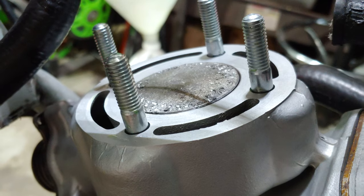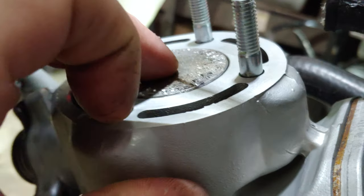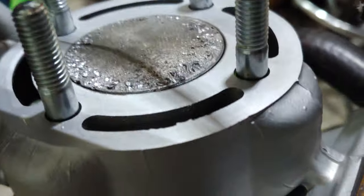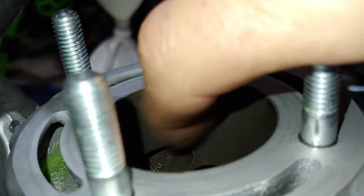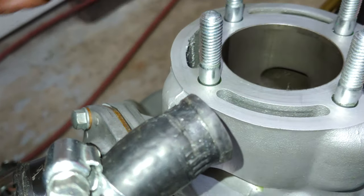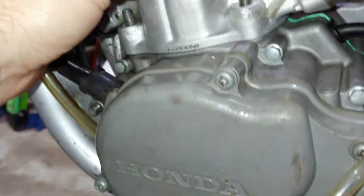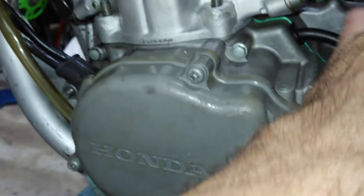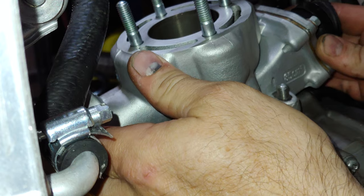At 12 to 14 thousand RPMs these things hit - I guess evidently that's enough. The thing is I don't know what happened here because if I crank it over, the cylinder is completely fine. You can see a little bit of stuff here but you can't feel anything. The cylinder is completely fine, still perfect, and it's like that on both sides. I think I definitely shut it off in the nick of time. It's got to be the crank, so I'm in the process of pulling the cylinder off right now - I wanted to do that on camera so you guys could see.